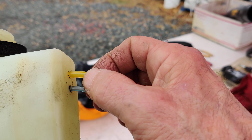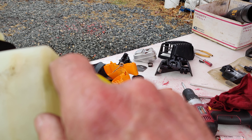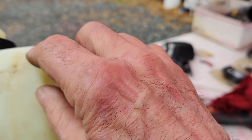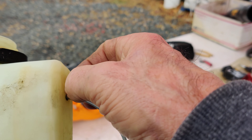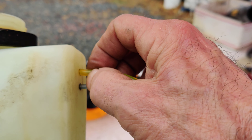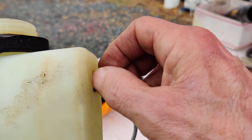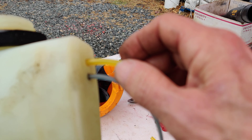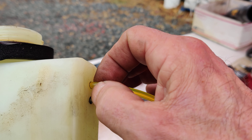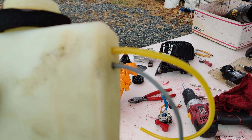This is the bigger return line — it only has to go into the gas tank about a half inch to three-quarters of an inch. I cut the point off so it was easier to get in, but don't worry about that — just make sure you stick it in far enough. This video has gone longer than I wanted, so I want to thank everybody for watching. Stay tuned for part two where we'll be putting it back together and seeing if it fires up and whether the carburetor is okay. I may also do a modification to the carburetor so we can adjust it as well. See you next time.